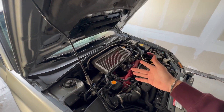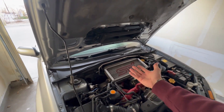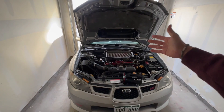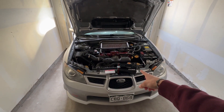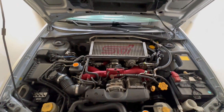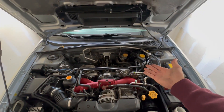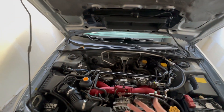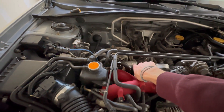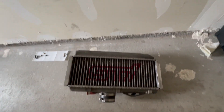Installation is very simple — all you do is take off the intercooler and the pitch stop is right there. To get the intercooler off, it's just two 10mm bolts and three screws to unhook from the fuel rails. There's also one bolt connecting to the brace, and you'll need to loosen the clamp connected to the turbo. Once all that's done, the intercooler comes off quite easily. Here it is — nice and simple, no oil in there, which is great.